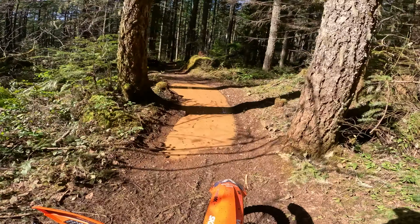I have done some other things to it. You can't see it right now, but I've got Del Saggio springs in the front fork, so it's a spring fork conversion. And that makes a huge difference in the rideability. Everybody talks about that stiction on the air forks. And yes, you can lower the air pressure down enough where it's great in some areas, but then you've got to change the air pressure to ride in other areas. So this is great. I have one setting.